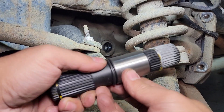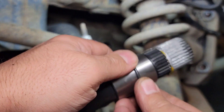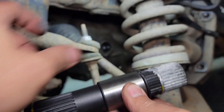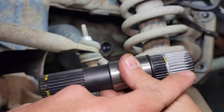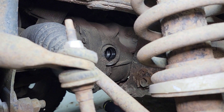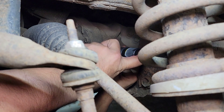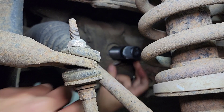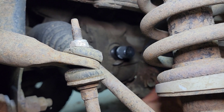Double-checking the old one — the o-ring was sitting on the wrong side, so make sure you roll it over so it goes in on this correct side. This is the CV axle side, this is the diff side. Now we're gonna slide this pin in here, line it up, and make sure those threads line up to the diff. Push it in, then grab a soft rubber hammer and pound it in slightly until you hear that snap — that tells you you're fully seated.